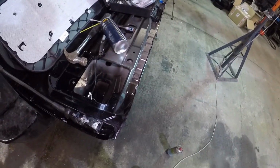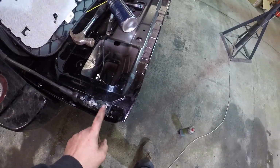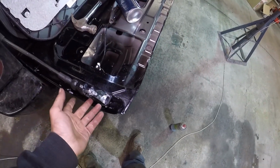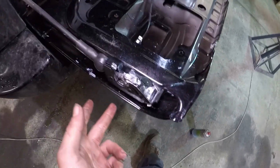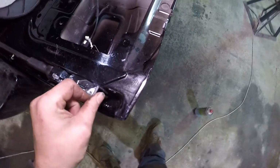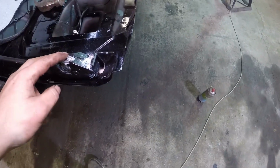So I can only assume that maybe the spring on the actuator had weakened a bit, and obviously the inside of the locks, without getting them apart to fully dismantle them and properly clean them up, maybe they still just had a bit too much friction. So probably your easiest solution here would be to possibly replace that spring and replace the outer locks. I'd imagine they're quite easy to come by. It seems to be quite a common issue, I think I've heard in the past.